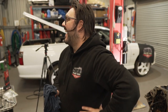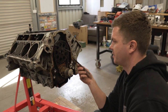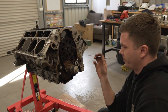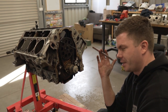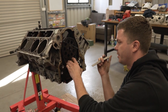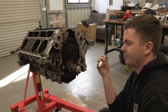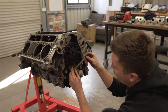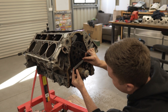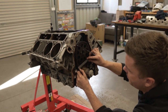We'll keep going. So like Nath was saying, the reason why we don't have a timing chain to replace it with is because we just completely forgot about it. We didn't even think about ordering one, so we haven't got one. Should we put one in? Probably. We don't know yet, because it sort of opens up a can of worms for us trying to replace this and removing this sprocket as well too. There's another special tool that you need to remove that, which we don't have. So there's a lot involved in it by the sounds of it. Book says that within 16 mil of play, you're right. So if I hold this at 20 here, and then I come back and I get down to 8, I've got about 12 mil of play.